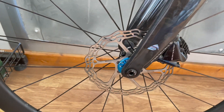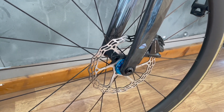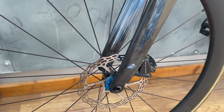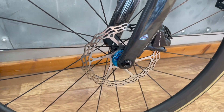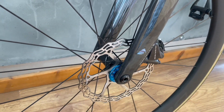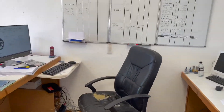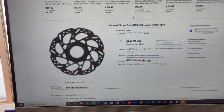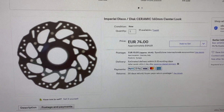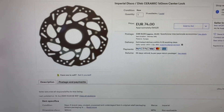I was using a 140 on the front because it was the only one I had that wasn't warped and wasn't giving me brake rub, but it's just not powerful enough. I'm only 65 kilos but I do like to brake hard — there's not enough leverage there. So I've got the 160 back on and I'll just have to live with the warping. Getting 160 centerlock discs is nigh on impossible at the moment, so when I stumbled across one on eBay I thought great, we'll give it a whirl — it's aluminium with a ceramic coating, and the price was okay, though everything is expensive right now.